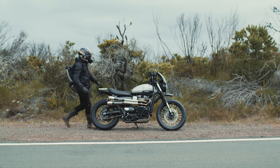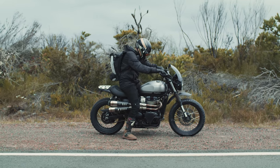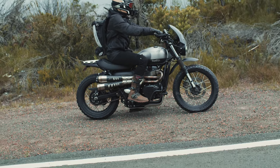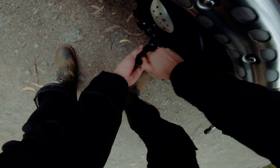The seat height is 790 millimeters. I've taken the Scrambler 900 out and they're a little bit higher at around 825 millimeters, and that is noticeable. I do wish the Street Scrambler was a little bit higher — it just feels like you've got a bit more control and it feels more off-road capable. I think you can raise these, but it's not a massive deal for me. Another cool thing about the foot pegs is that you can take the rubber inserts out when you're trailing so you don't slip off when you're chucking those sick wheelies.